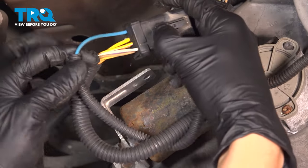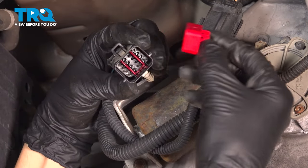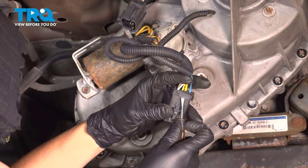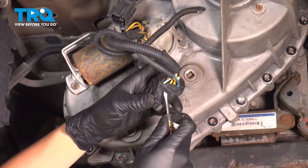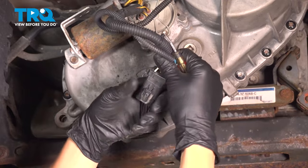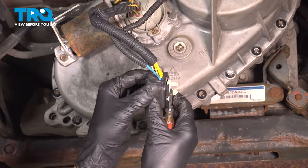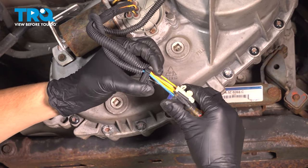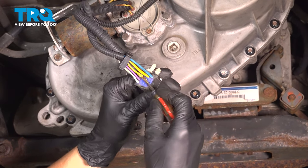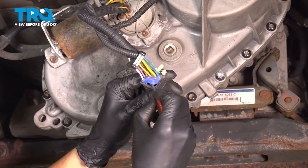Once you get this out, we actually have to de-pin this wire over here — the blue one. On the inside of the connector, take out this red piece. On the back side of the connector, where you see all those wires going in, pop off this cap. Use a little pocket screwdriver and just pry it out. This will give us access to the back side of the pin. You want to slide this back on the harness, just like this. There's a silicone or rubber gasket here — pry this out as well. We need the wire to come out through the back side, which is why we're doing this.